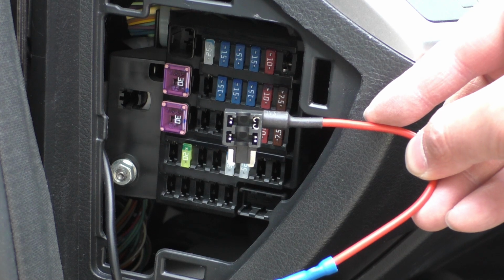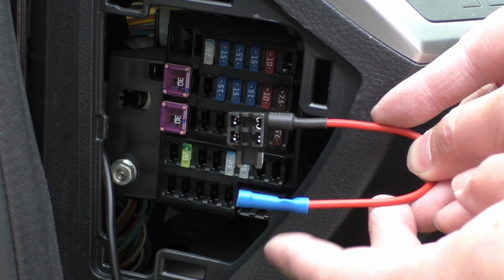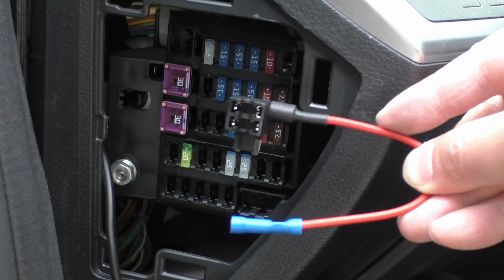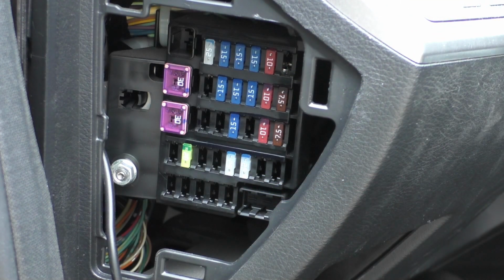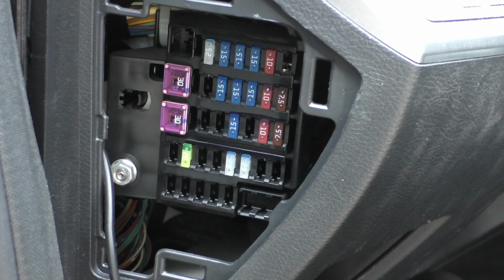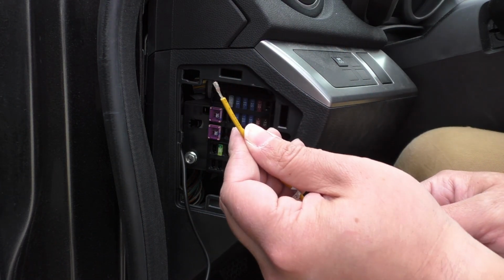this add a fuse. The top fuse slot is going to control the current going to the extension here, and this tap or the extension is where we are going to connect each one of these yellow and red leads, each on their own individual one. So let's go over how to couple the add a fuse to your wire lead.